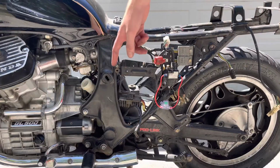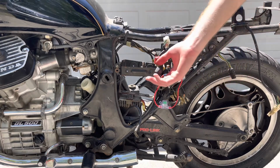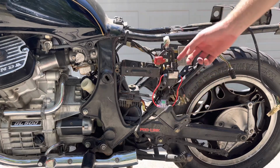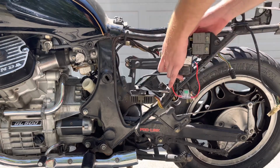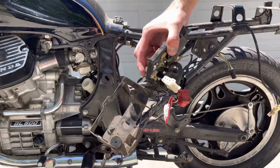With pulling that bolt off of the coolant reservoir, it was just one of those that takes about 3 extensions and you just have to close your eyes and feel for it. But with that, the rest of this is ready to come out. I went ahead and removed this cable, which is for the starter motor that comes from the battery, and that's the rest of it. So just a little shake and a twist, and all this stuff's out of there.